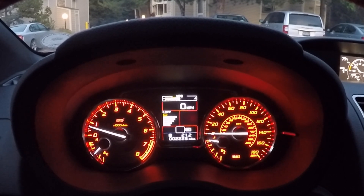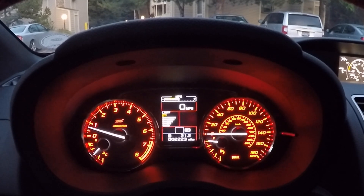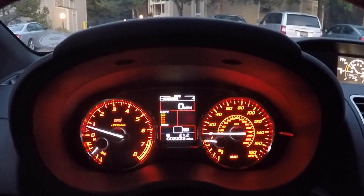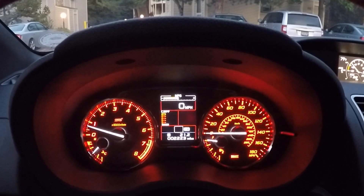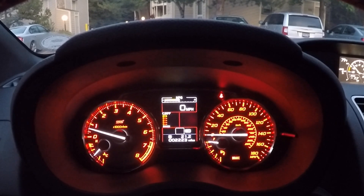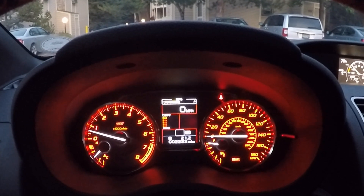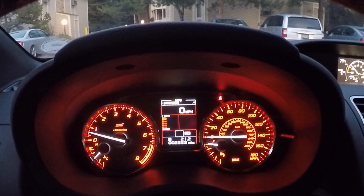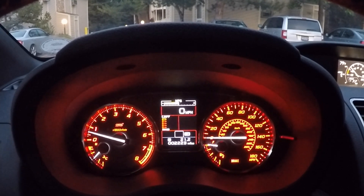This is a little bit higher lockup, so it's going to give me a little bit more bias toward the front of the car in terms of power. And I can reduce it back and give it a more rear wheel drive bias. But you can do the same thing by going auto-minus instead of going full manual mode. Because if you're not sure how all this works, how it affects your drivetrain, what surface you're on, and you start messing in manual mode, you can definitely do some damage to your drivetrain. So that's why most people should just stick with auto-plus, auto-minus, or full auto.